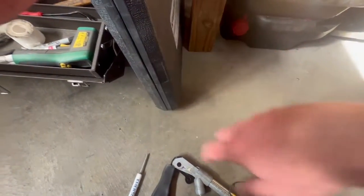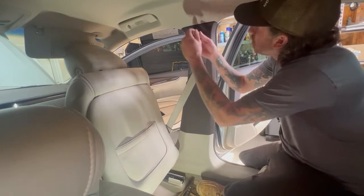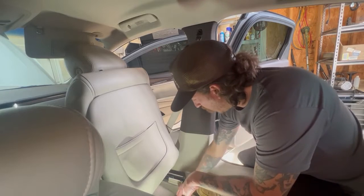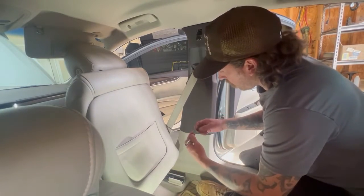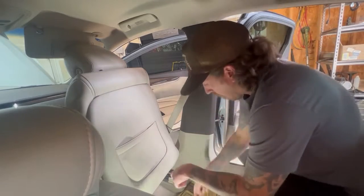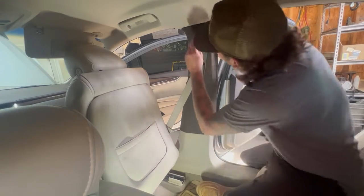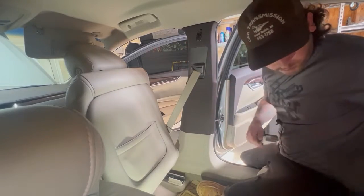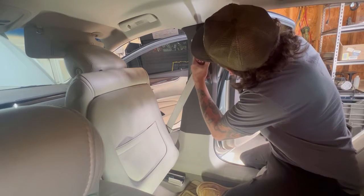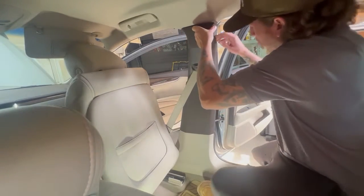It's been a few minutes with the battery disconnected, so let's get started on this job. Where I like to start: there's a little tab up here that says airbag. Just pop this guy loose and you'll see down in there it's a seven mil. I like to use a magnetic socket for this because this little nut, once you get it loose, will want to fall all the way down and then it'll be a nightmare to find. This takes a seven mil — if you don't have magnetic sockets, just make sure to have a magnet nearby.